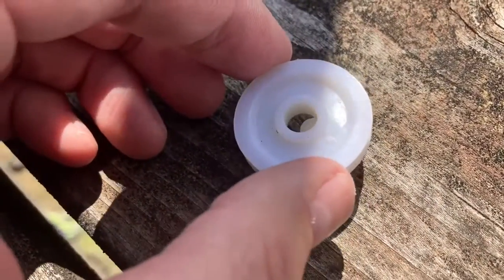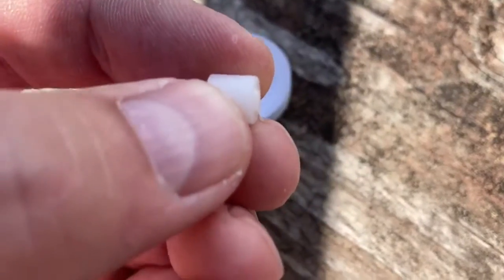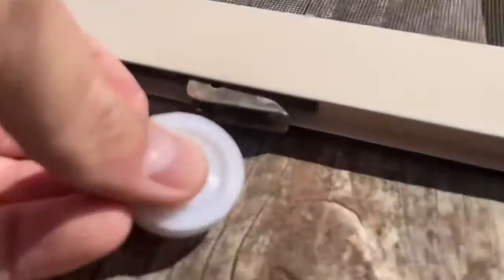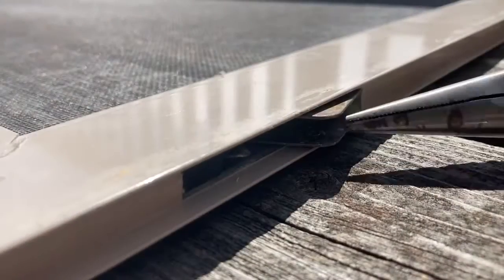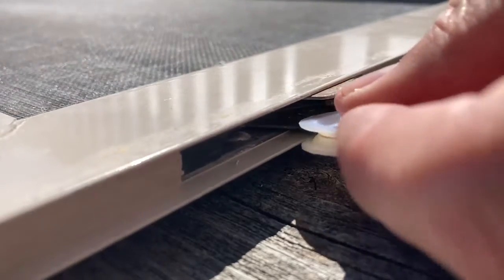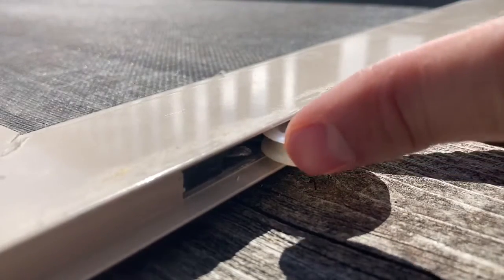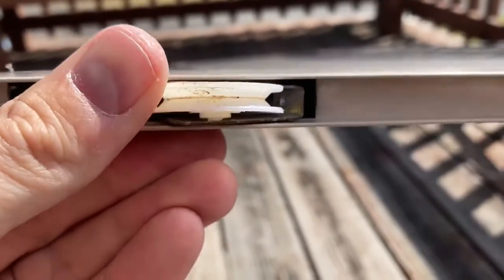The white part of the wheel was jammed too far within that metal piece. Now the wheel has this little spinny axle, and you can see it kind of sits like that. On the ends of the little axle are two plastic pieces that are supposed to seat in these holes right there in the metal — can you see them kind of sticking through there? The idea is that we need to take that piece out, reposition the white piece, and put it back in.